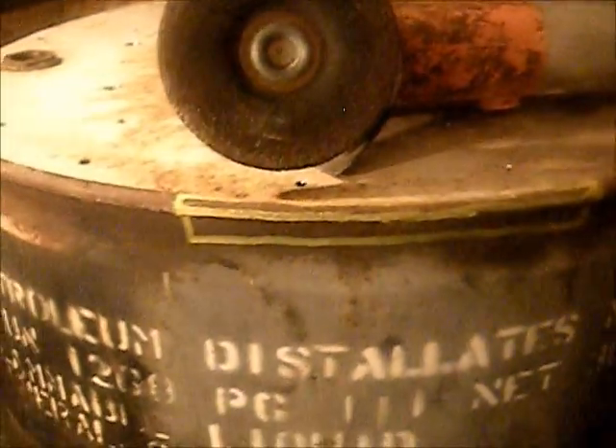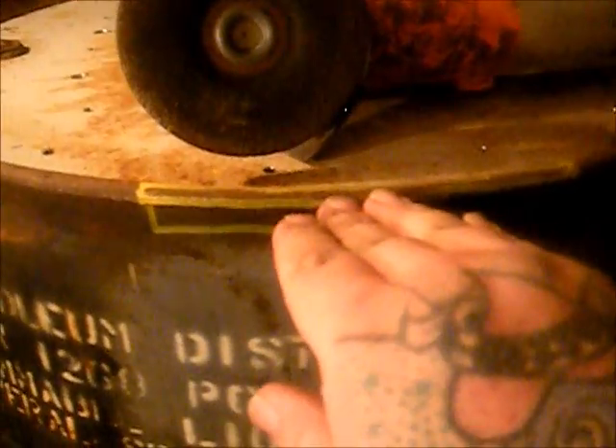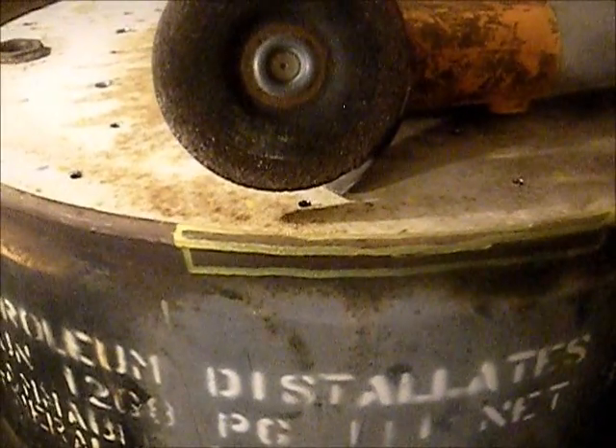You can see where we have it marked — right there, right there, and right here. We're going to cut that out with a grinding disc. If you have a cutting wheel you should probably use that; if all you have is a hacksaw that works too. This will give it plenty of airflow, and you'll still have the whole rim holding it about three-quarters of an inch off the ground. The cuts are roughly six to eight inches wide, eyeballed in a cross pattern.